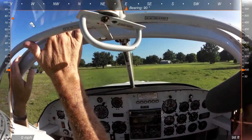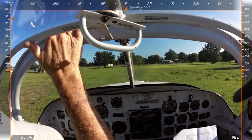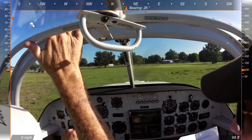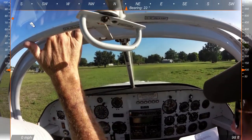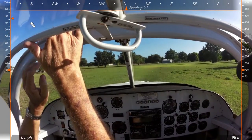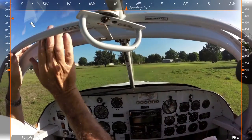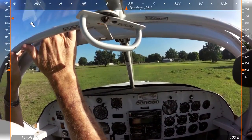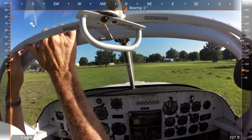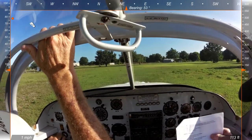All right. So now we can do a step to mag check. Okay. Altimeter set. We got that. Mag check at 1800 RPM. The altimeter is about 38 feet. What's your RPM? Yeah. Oh, here it is. And use your vernier. Get a feel for how sensitive it is, and 1800 is pretty high, so hold your brakes real good. This is a dual single Bendix mag, and it tests at 1800. Okay. I'll give you your mag check.